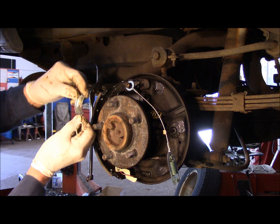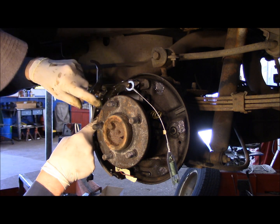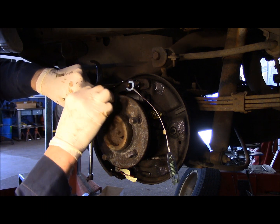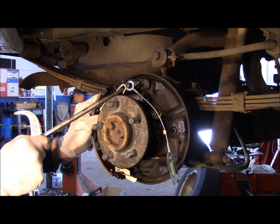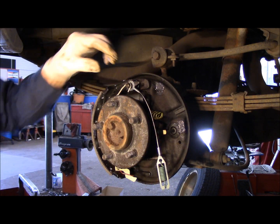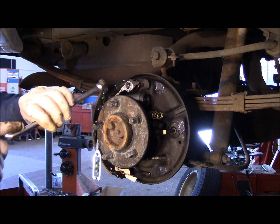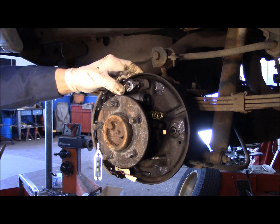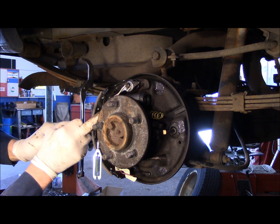Okay. Then you take your rider here. Remember I talked about that piece got to go into that hole. You put it in the hole like that. Hold it with your finger. Take your spring. Put your spring in. Still holding that rider with your finger. Rotate this up like this. You got to take your tool. Hook the tool over the top like this. Take this over the top like that. And now take this around like this. Right? You take your tool like this and you bend that spring closed all the way, and that part is pretty much done. Our rider is in the correct location.